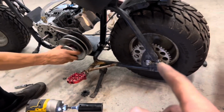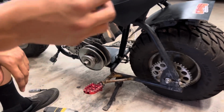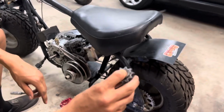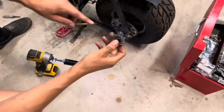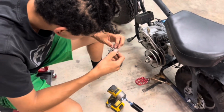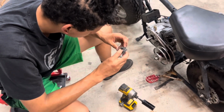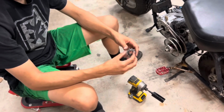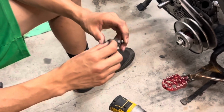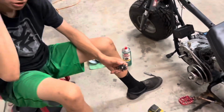Next, we're gonna put our chain on and align the motor. Off with the 10 tooth, starting to get worn as you can see. Look how shiny it is, I got some chain wearing away, sharpening it. It's crazy. Never really seen that happen to a sprocket before. That's from all the sand in there from Busco Beach, riding around, grinding through the chain. Eats away your sprockets and stuff. That's why it's important to lube your chain and clean it, especially after you ride in sandy, dirty kind of terrain.